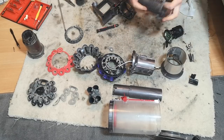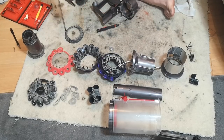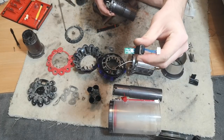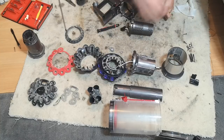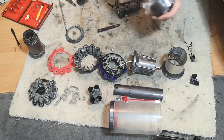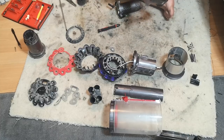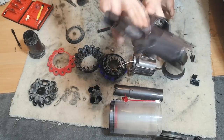What I do need to do is feed the little wires back through - there is one little tiny wire which needs a bit of persuasion, and then the two huge thick massive ones. I've also got to feed the circuit board in. The little wire sits on this black connector here and simply pushes down over it. To get these beefy power connectors off I did have to bend the crimps, so bend them back. They are actually these two stout screws here and they just screw back in.